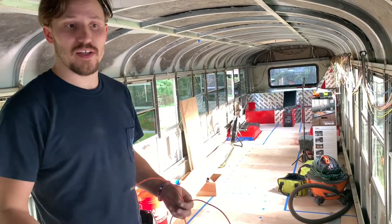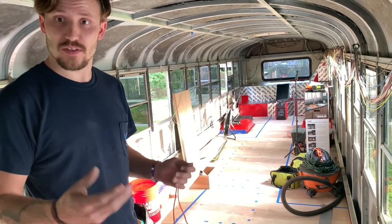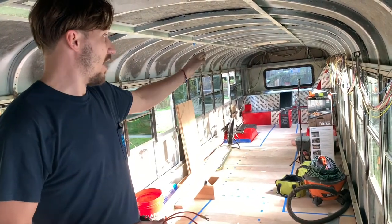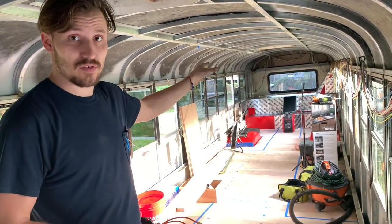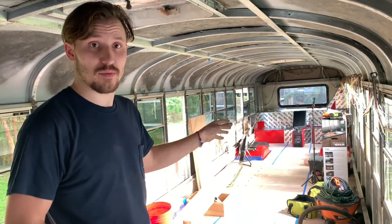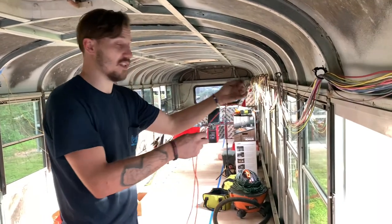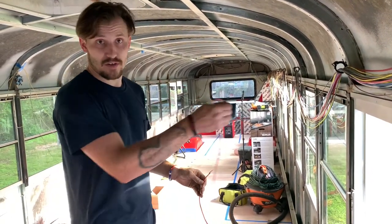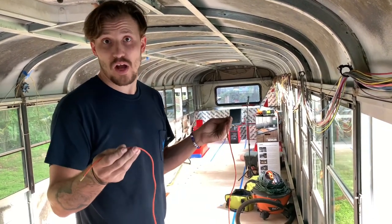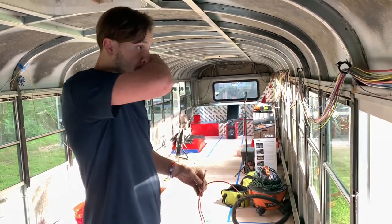In the process of eliminating wires and choosing the correct ones, it's best to start at your control panel and see what you have there — it's normally on the outside of the bus. For example, we had an AC unit with a whole bunch of electrical wires running back to it. We knew those wires were eventually going to be removed. On one end it ran along the whole length of the bus to that AC control panel; the other end ran to the front. We knew this was our only orange wire, so we could automatically cut it at one end or the other and feed it through to pull it out.